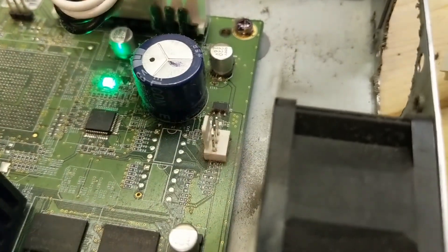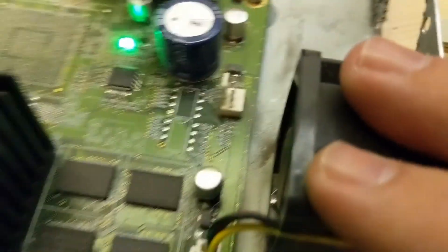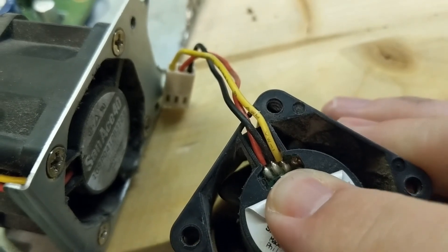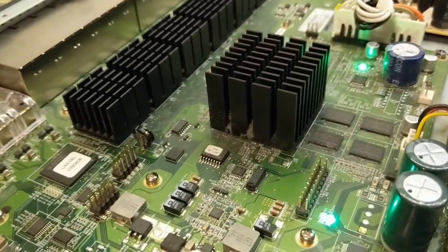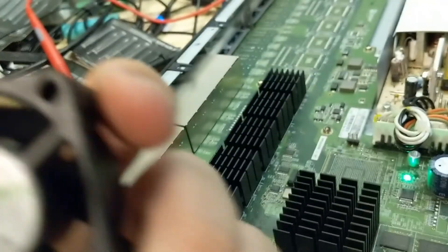It's got a little alarm light because that fan's unplugged. There's an alarm — I don't really care that two fans aren't plugged in — but it's still loud. So the plan is to unsolder those connections right there and then connect that to this fan.